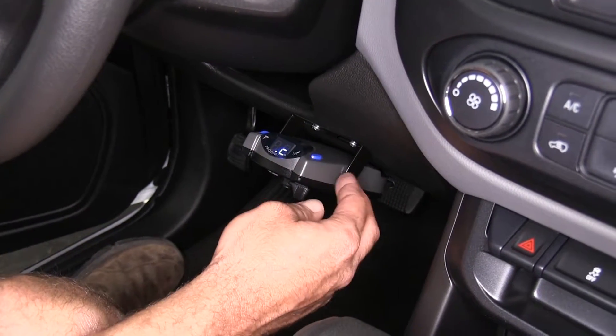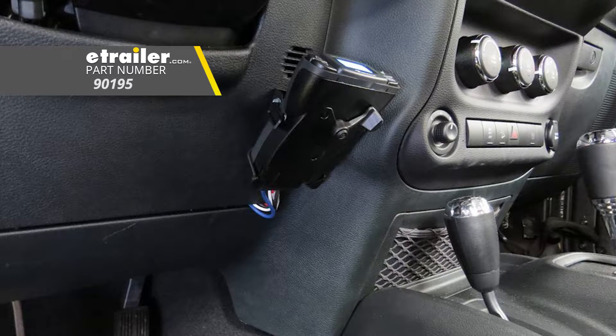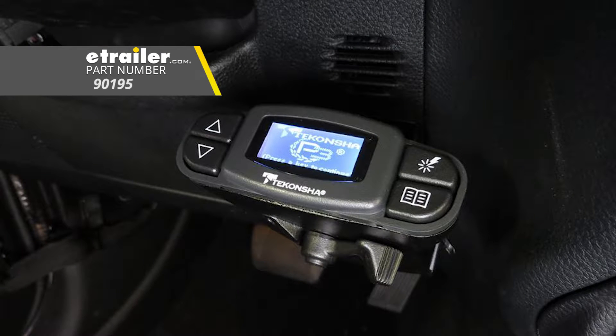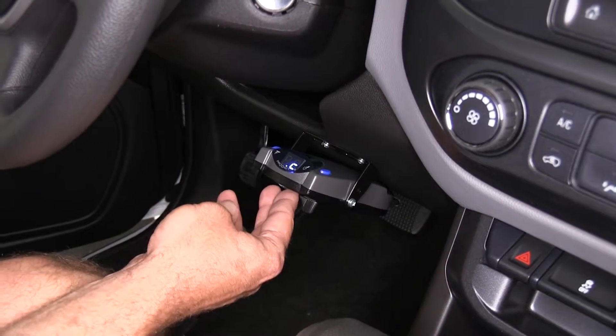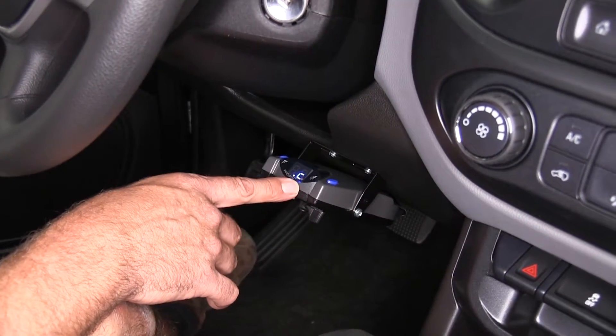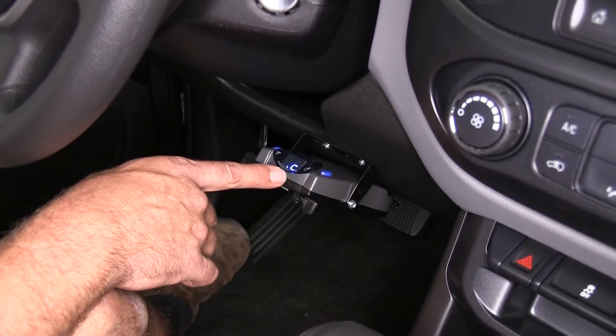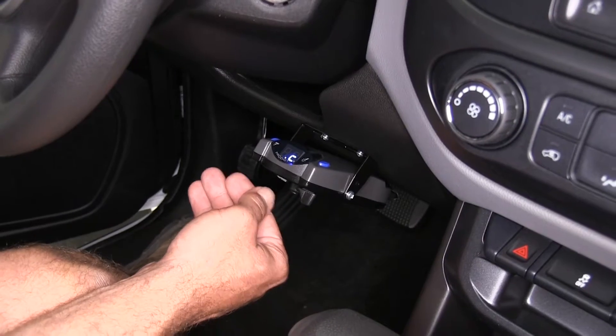Comparing this to other proportional brake controllers, the P3 is one of the most popular ones on the market. They're made by the same company and share a lot of the same technologies. With the P3 you have more mounting options — just about any direction as long as it's in line with your vehicle's travel. The P3 also offers more diagnostic functions and more customization. You're not really going to upgrade the braking performance by going with the P3 — it's just going to be more interactive with more information and the ability to change colors. For someone who tows every single day the P3 might be the way to go, but for a weekender, occasional use, or someone hauling with the same trailer without needing many adjustments, the P2 is a nice cost-effective controller that works for one up to four axles.